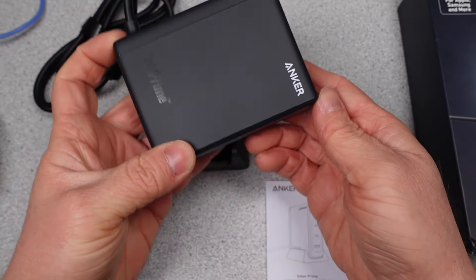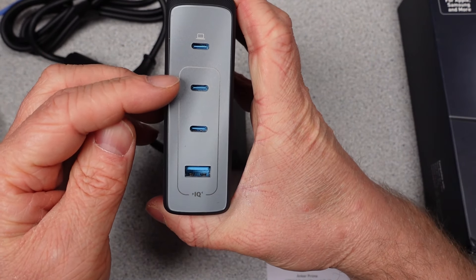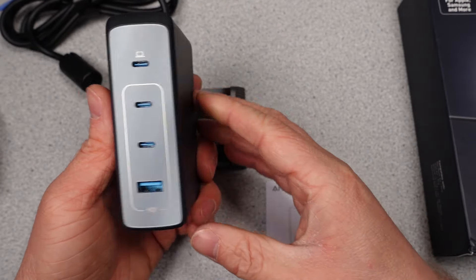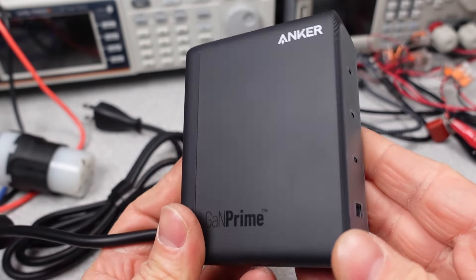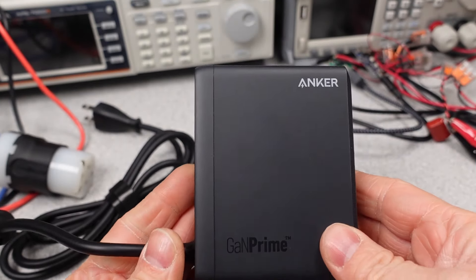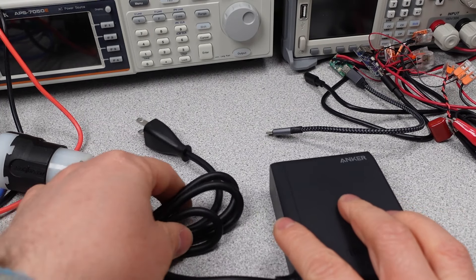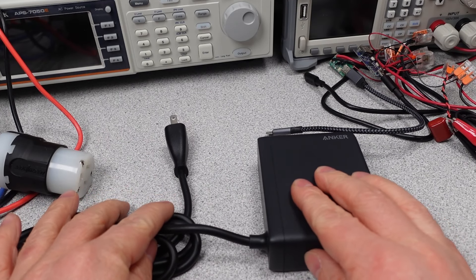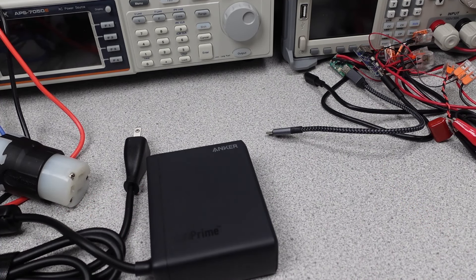That's well within the wheelhouse for this thing. It does lack a 12-volt mode on the USB-C ports. The USB-A port did have some interesting modes though, like the ability to do 5 volts and 4.5 amps. So I wonder if this would be able to do the higher output required for something like a Raspberry Pi — but you'd need a USB-A to C adapter, and that adapter would have to convert the mode from a QC mode to a PD mode. Annoying, but technically capable. Another thing that will tick people off is the non-removable power cord. They carefully hide this in the marketing material.